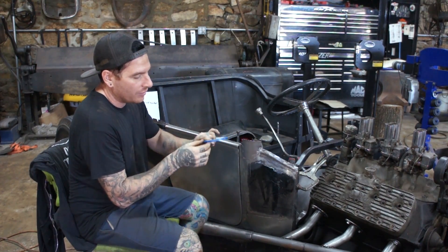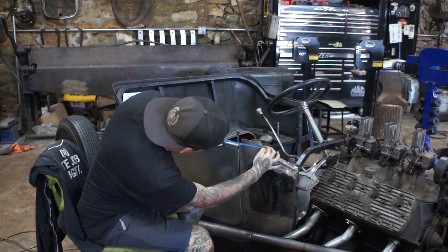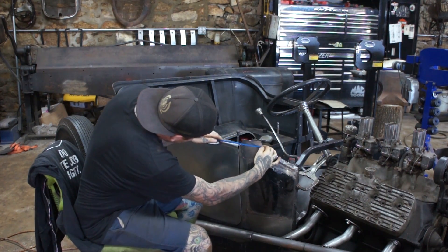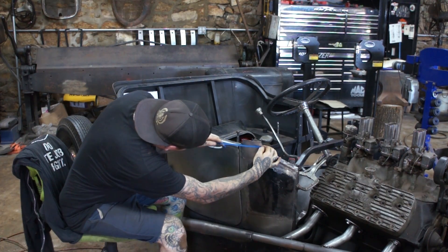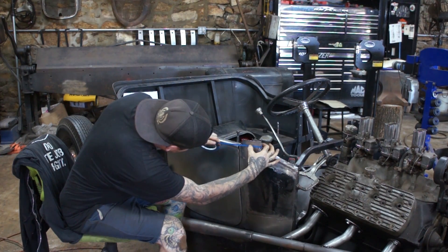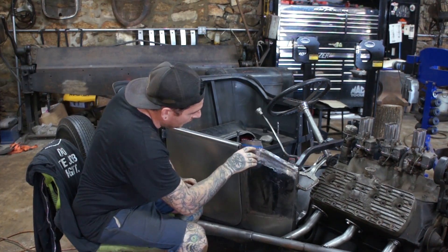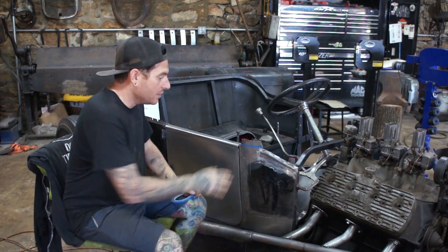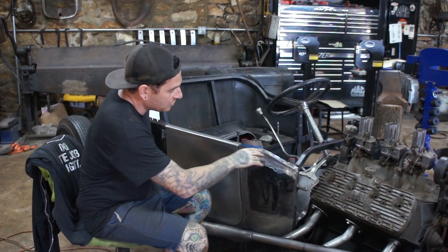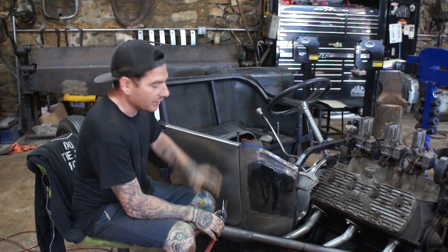I'm going to take some pinstriping tape here and I can put it right where I want it to start. I can kind of eyeball it, wrap that around, and you can eyeball where we want the cut line so it lines up there. I can use that as a guide, or we can run a scribe along the bottom edge of that, and we can then cut on the scribe. I'm going to probably cut right on the tape and then sand it smooth. This is all hidden when you put the cowl on top of it, but we obviously don't want it sticking up higher than it needs to be. That's a little tech tip — if you guys are welding in small patches, leave them a little long on the edge and you can use it as a heat sink.